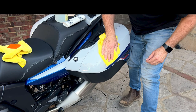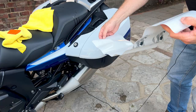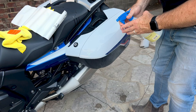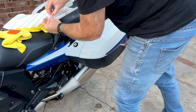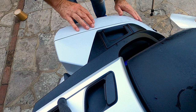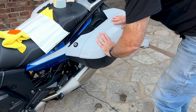Give the panniers a wipe off first to make sure there's nothing underneath that will show through the film. My panniers are brand new so there shouldn't be much grease or grime, but if you do have grease or grime wipe lightly with methylated spirit first. I'm also wetting my hands so I don't get fingerprints on the inside of the film. Now we've got a film for here, here and here — the big one goes on first. Spray hands, spray the panniers, remove the film, spray the inside of the film, then position it onto the pannier.